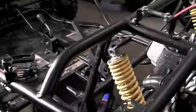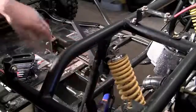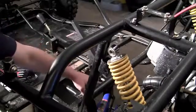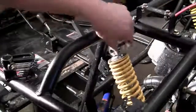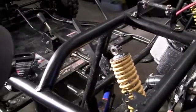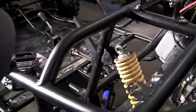And if you guys don't know what I'm talking about, then I'm about to show you. So once again, as you can see, there is no possible way that this strut is going to fit in this bracket, even if you were the strongest person alive. So what I did is I positioned the jack right in the middle of the go-kart where it pivots, and we're going to start jacking up. Now, go ahead and pay attention to the strut and bracket placement as I begin to jack it up. As you can see, it gets closer and closer and closer.